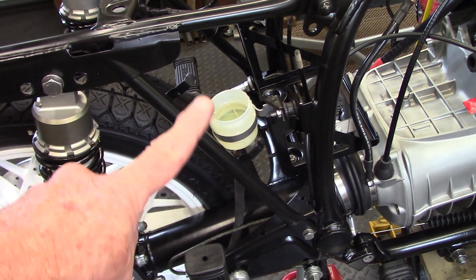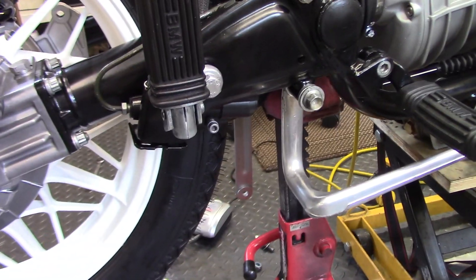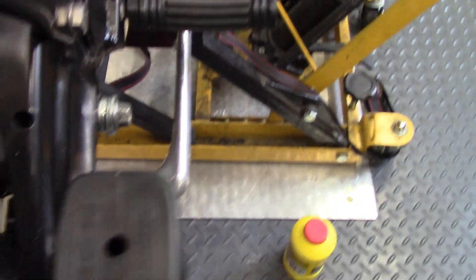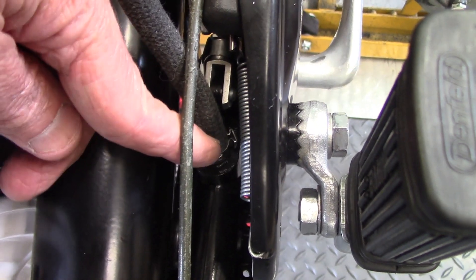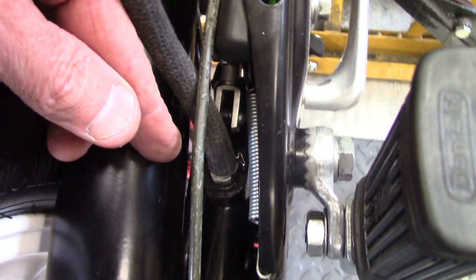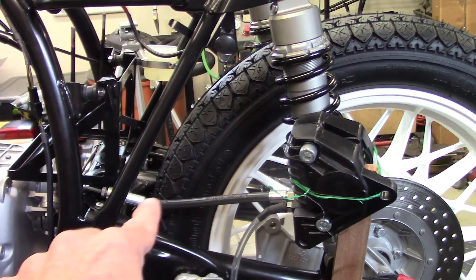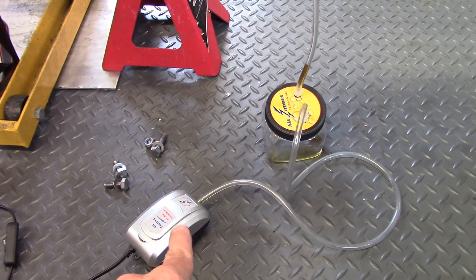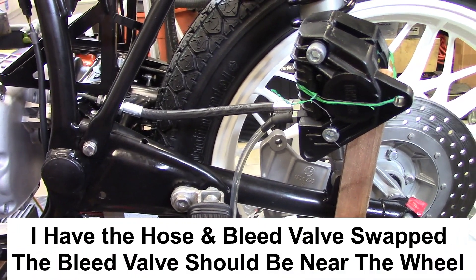Brake fluid has been put in the container for the rear master cylinder and everything is installed. The brake pedal is on, though the back locking nut is a little loose so the pedal moves freely, and the spring is routed — it fits in between the fluid hose and the bolt, passing by the face of the nut so it won't rub on anything. The rear brake caliper has been suspended on the shock so there's a slight uphill run for the brake hose. This is the bleed line going to the air zapper, a little vacuum pump that pulls fluid out of the bleed nipple.